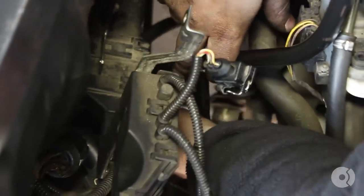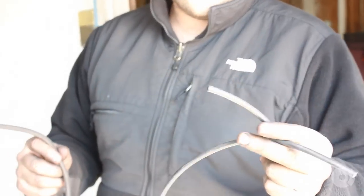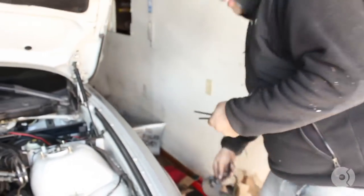I'm going to slide the drain tube onto the dipstick and push it down until it's seated all the way. Before reinstalling everything back on the car, the last thing you have to do in regards to the PCV system is install this vacuum line. You could reuse the old vacuum line, but as you can tell it's kind of dry rotted and will probably fail. This stuff is usually pretty cheap anyway, so might as well just go ahead and replace it. It attaches onto a nipple on the side of the PCV, which is towards the bottom of the valve.